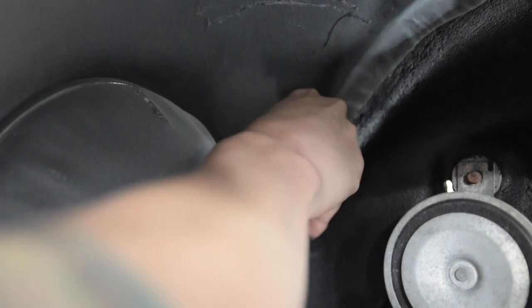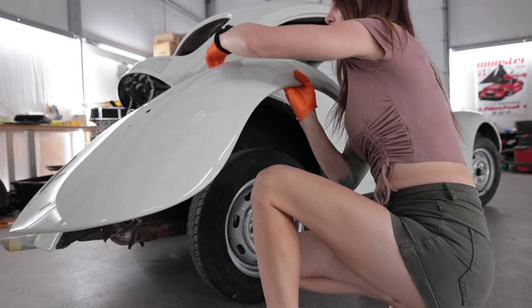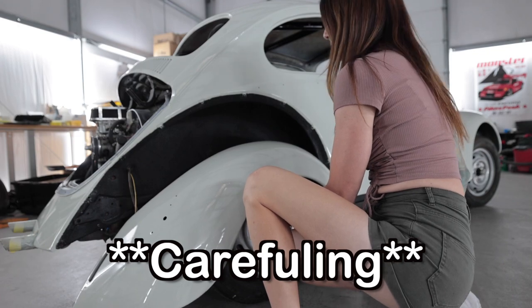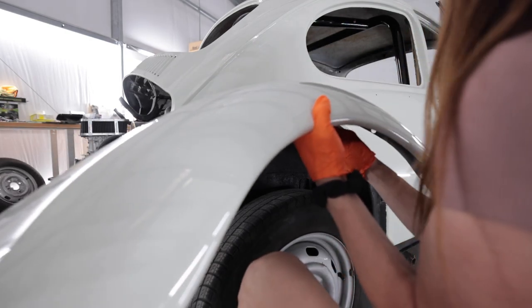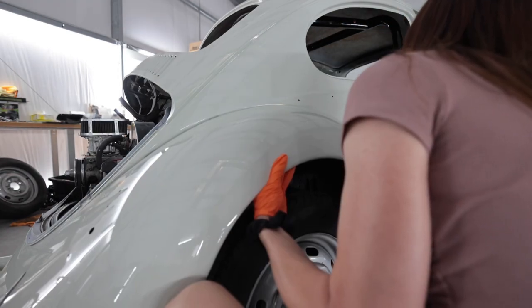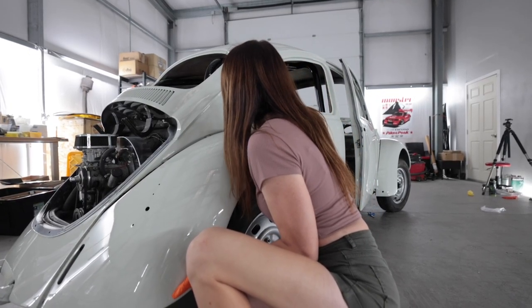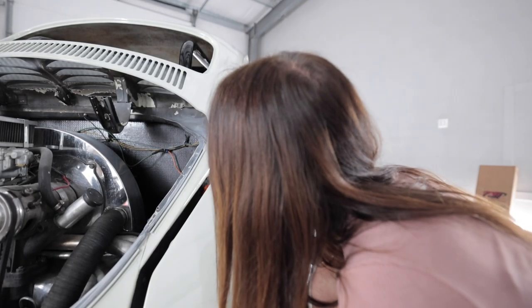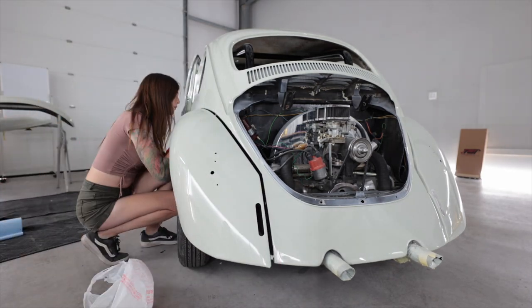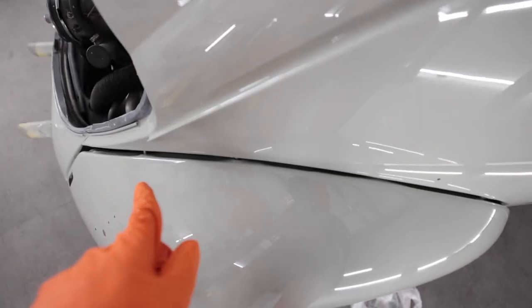This one's gonna suck. Got it. Now this side — get it balanced on the tire again. Just like that. If you're wondering what my plan is for doing the rubber undercoating underneath these fenders, I'm gonna do them with it mounted on the car on the lift. I just think that's probably the best way to go about doing this, so I can make sure I get up in the seam between the car. It's plenty of room to get the rubber in here.